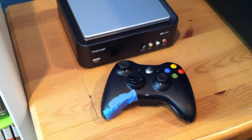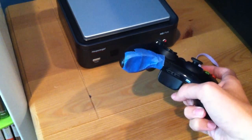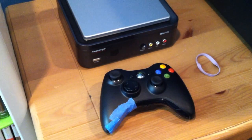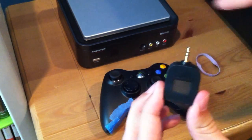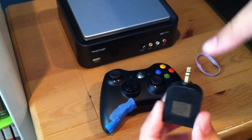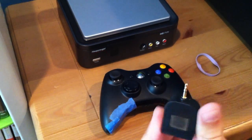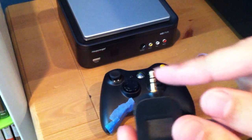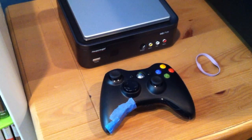So you're going to need a variety of adapters. First, obviously, your controller — optional where you don't want to smash it on the ground and break it, but that's my controller. The first thing you're going to need is a 2.5mm Y-splitter adapter — stereo. Now, 2.5mm Y-splitter, also known as what most phones used before they started using the 3.5mm, like for an iPhone headset.